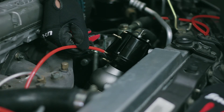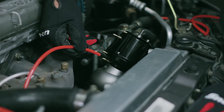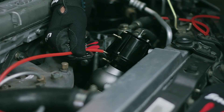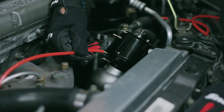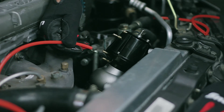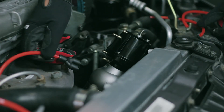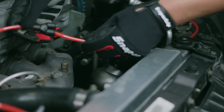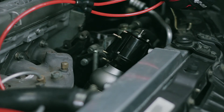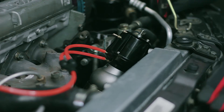If you put the boost source to open the gate on port C, you're going to have 10 pounds of boost. If you want a little bit higher boost, you take the boost source and apply it to port D instead. So using just one vacuum line and one port you can already have two different boost pressures. Now if you want to make a lower boost pressure, you use a T fitting to tee off the same boost source and apply boost pressure to multiple surface areas, which produces a lower boost. By teeing off the boost source you can apply it to both ports C and D and make an even lower boost pressure.